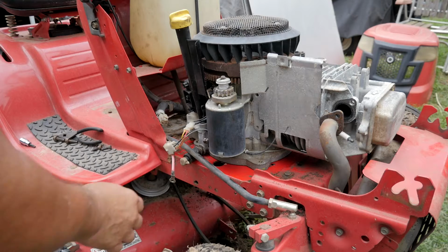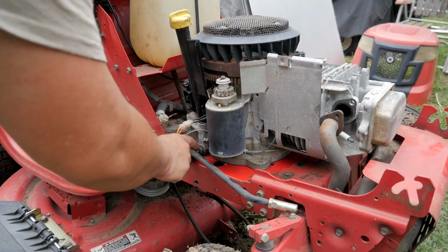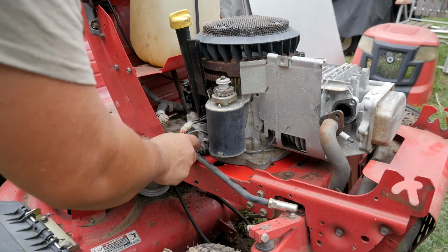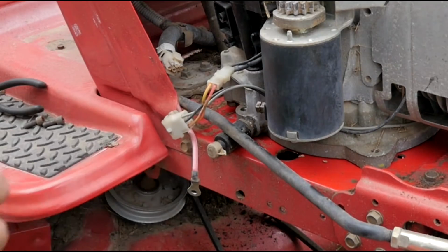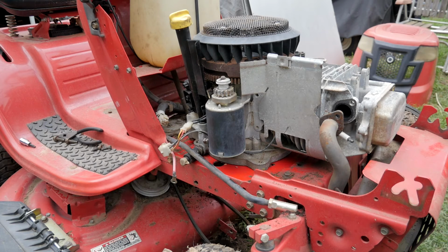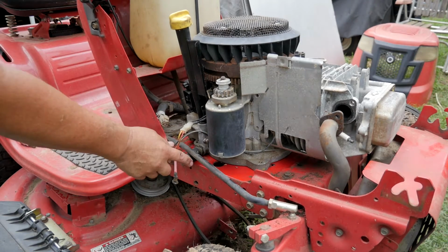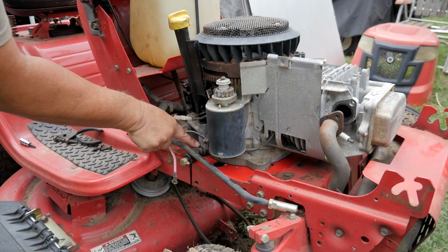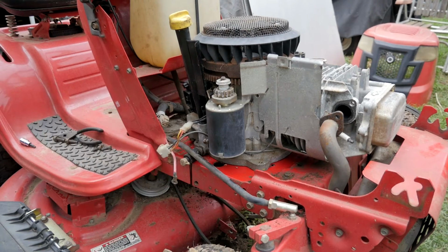What about the other motor? What's it doing? I think the other engine had a smaller plug and there was no interference there. Let me take a quick look. Yeah, that's exactly what it is. So I'm going to go ahead and drain the oil out of both of them, and put the smaller plug on this so that there won't be any interference on your arm there with the steering.